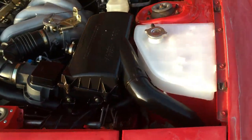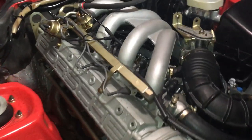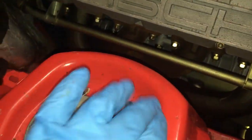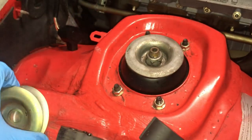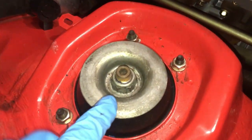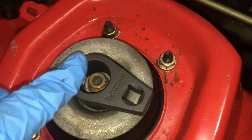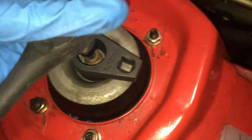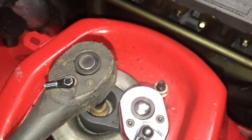Then I've got to just try and finish some of this body work here, and this thing will be ready to go to paint. The engine bay is looking pretty good. However, there are a few areas mainly right here that I need to clean up. You can see on this side I've already got some new nuts put on here, and I need to replace this tired-looking strut hat on this side as well. I have one for each side that I'll be replacing. In order to remove this, all you need to do is remove this nut here. The easiest way to do that is to use an offset oxygen sensor tool and just put it on there. Then you're just going to take a 6mm hex key and stick it down in the strut just like that and turn it, and it should come loose.